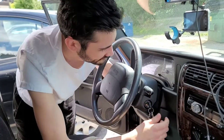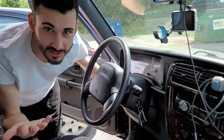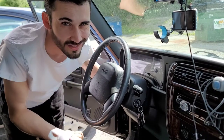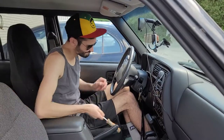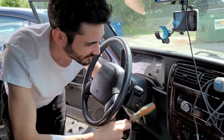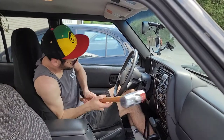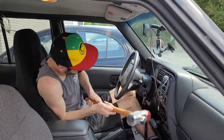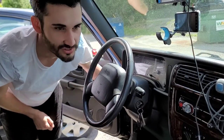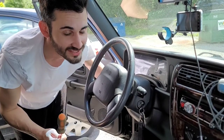We got the key in here and it won't move. No matter what you do, you move the wheel, it's not gonna turn. The temporary solution — grab a screwdriver, anything with a heavy handle like this — and you give it two little taps. And the key will turn and you can drive your car. Now if you just need a short-term solution, that's enough, but eventually it will stop working.